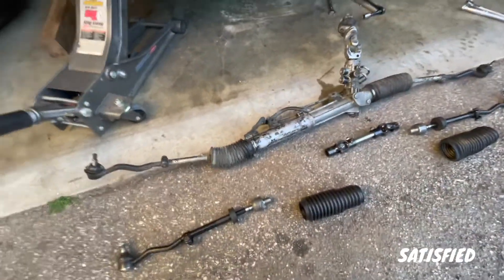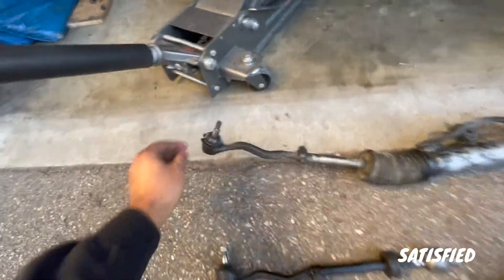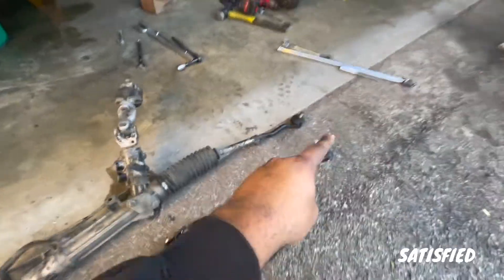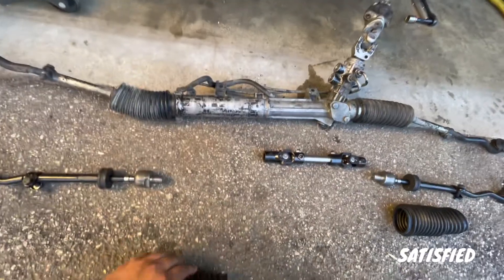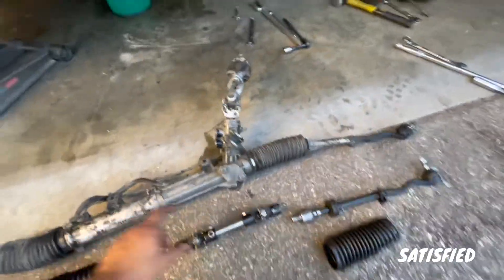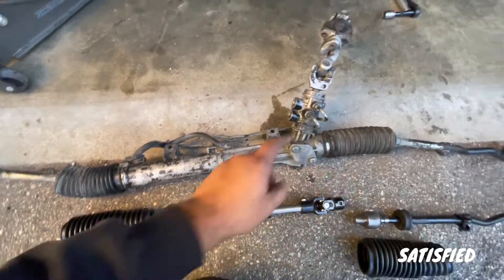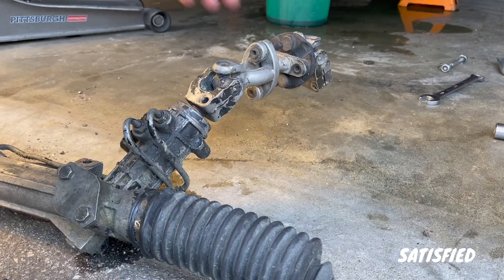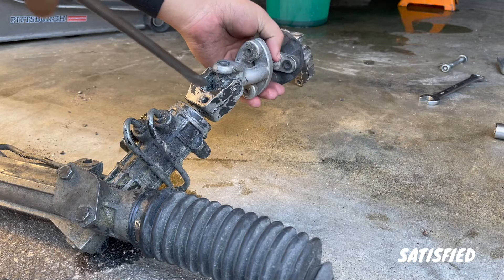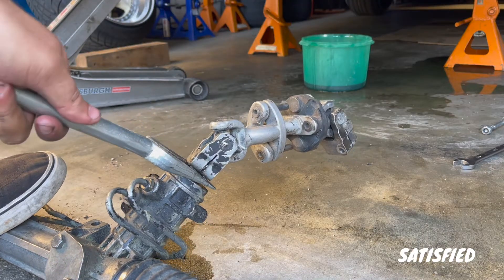All right guys, give or take about 20-30 minutes, I got the steering rack out. Of course I'm going to be replacing the steering rods because the steering rods on the steering rack are completely shot — same thing with this side right here, the whole boot ripped up, even the ball joints are showing. So gonna be replacing those. Unfortunately I won't be able to put everything together because with the steering rack there is a clamp that comes with it to secure it in place and I do need to order some because the ones I ordered didn't come with them at all. So right now I'm probably gonna take off the coupler and then put on the Condor Speed Shop one and see what we do from there.